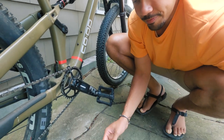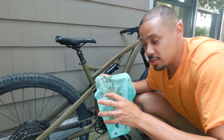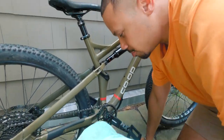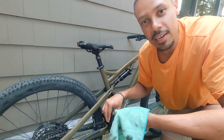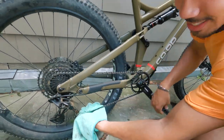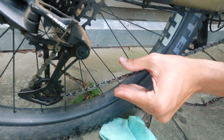Now a very important part — arguably just as important as putting the lube on — is taking off the excess. Lube is wet when you first put it on, and if you ride through dirt, it's just going to attract and hold on to that dirt, which then works its way into your chain, cassette, and drivetrain. So now that everything is lubed, grab the chain lightly. Note that all the spinning has been backwards, because when you pedal forward it moves the bike forward, so you can't do that stationary. You just want to collect any excess lube that worked its way to any other part of the chain except inside the pins. Squeeze top and bottom, and also on the sides, to collect the excess from any spot.